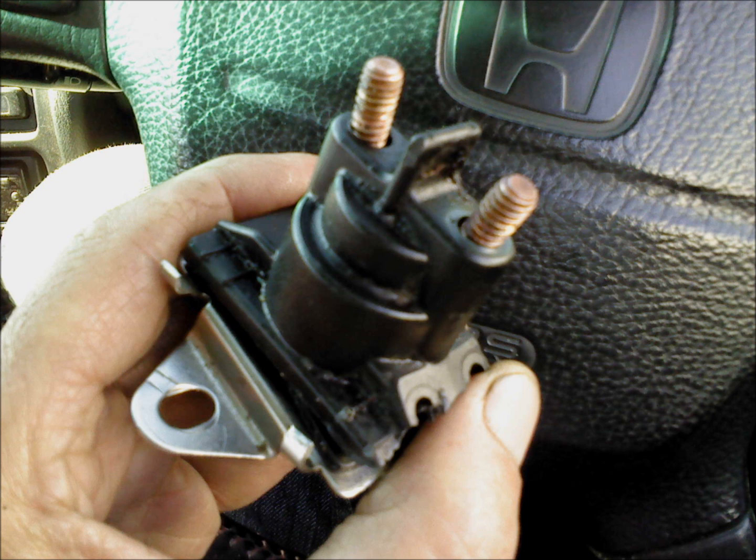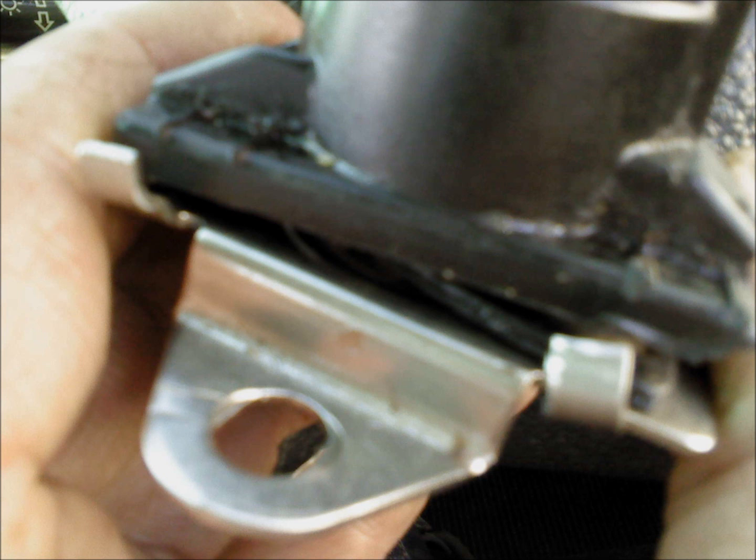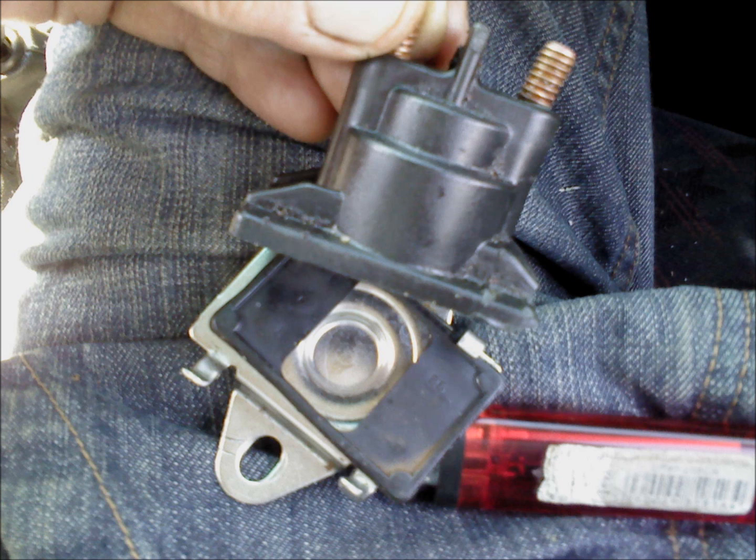There's your primary solenoid taken off the plate at the back of the engine. The problem symptoms were a clunking only half as loud as the solenoid on the starter motor. When that clunks, if you've got a flat battery, the symptoms are the same — it's just a little clunk and you think you've got a flat battery.